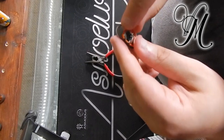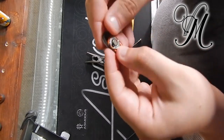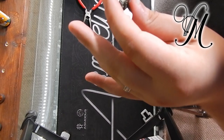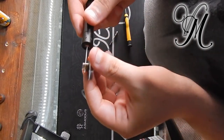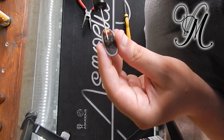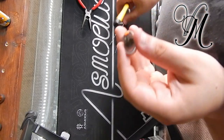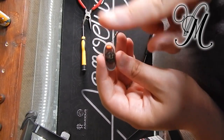Pull your other legs to the other side, then bang your centre pin back in — done. Make sure the coils are still alright: you want them in line with the bottom of the hole. If they're any lower you won't be able to wick properly. They can be a slight bit higher, but you want them to be as centred as possible. That's both of mine done. It is extremely fiddly.